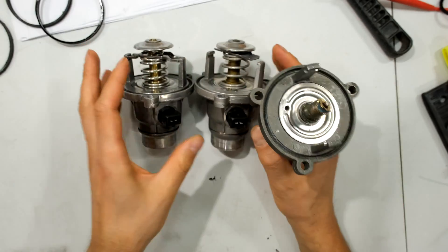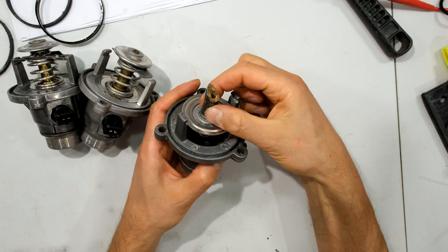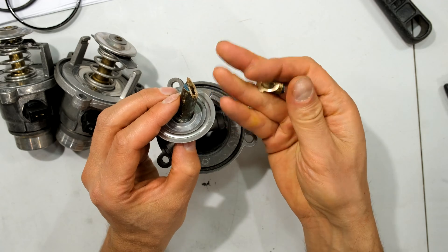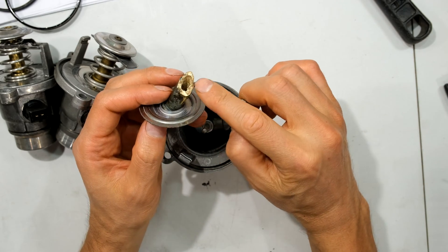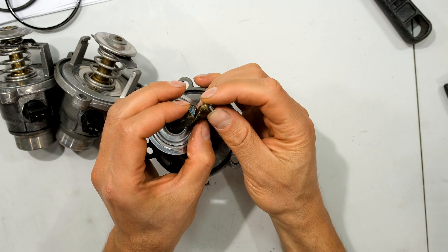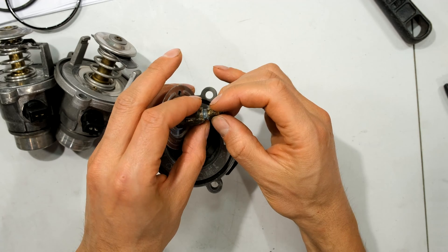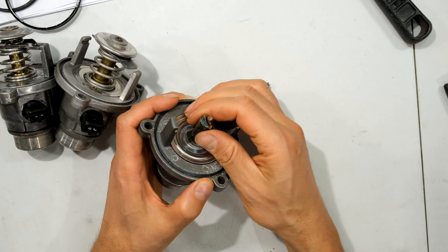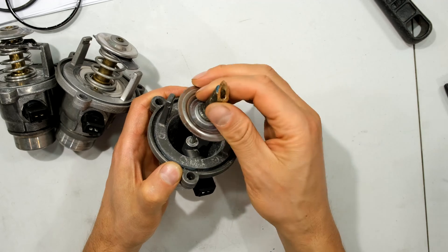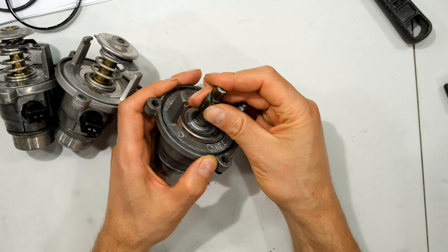Here's an older one which I've cut open — I wanted to demonstrate what's going on inside. This is a solid piece; I originally thought it was made up of two pieces, but when I cut through it there's no seam. I think there's a safety feature built in — I'm speculating that there might be another type of wax or a wax with a different temperature coefficient in this area. This particular thermostat was stuck in the open position, meaning the needle in the middle could not go all the way in — something had expanded and locked it open.